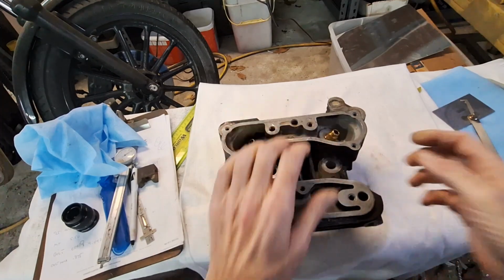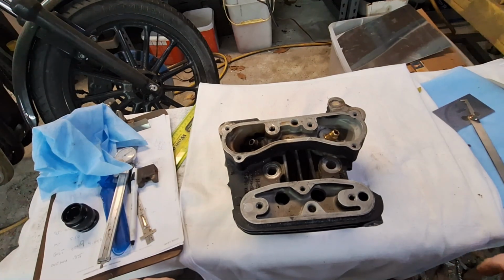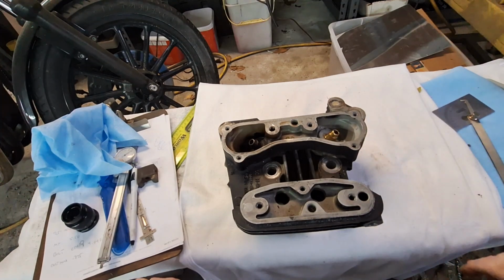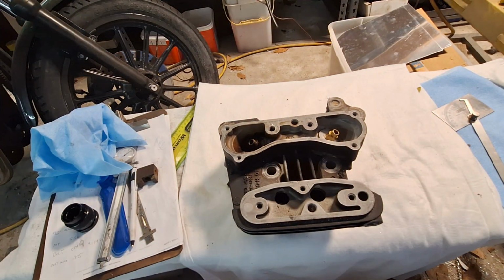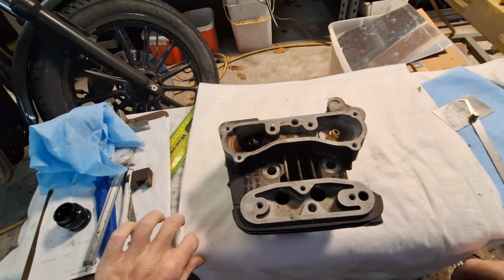Now, sometimes I've gotten heads before that are like STD heads. I guess, what was that guy's name? Lou Trachtenberg used to make them, and they might still. I don't know, I haven't bought any in years. But they had a 3/8 inch raised intake port, or you could order them like that. I think the last time I bought some was maybe 10 years ago, and ordered them with the 3/8 raised ports. But this stuff always fascinated me. So we'll go back on that.